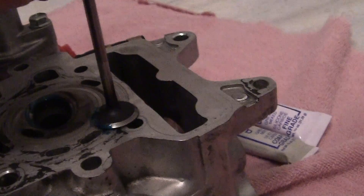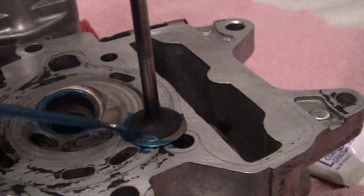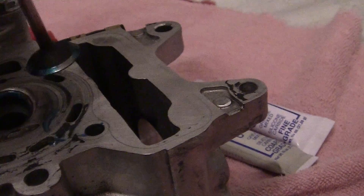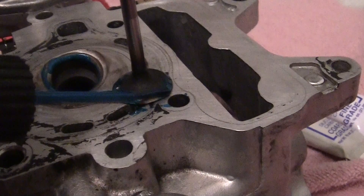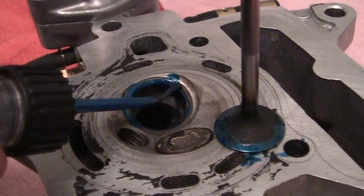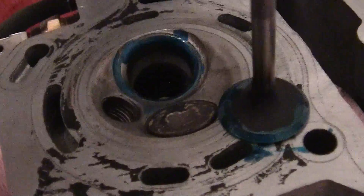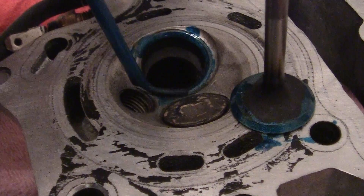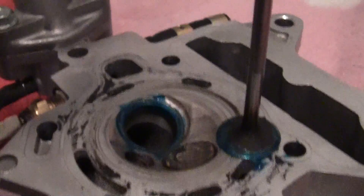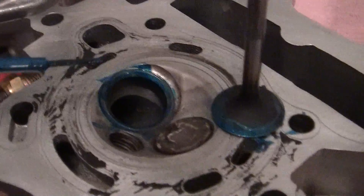It's got a neat color — I might just leave that on there. And this is lacquer; it air dries very quickly. This is not hurting a thing. Actually, this is probably too much lacquer on there, but that's no problem. I'll let this sit overnight. Most of the seating area hasn't been really cleaned up, so it's got kind of a light coat of oil on it. These two places here are where the valve seat and the valve itself are going to be touching.